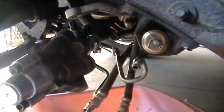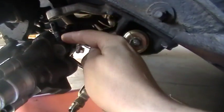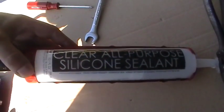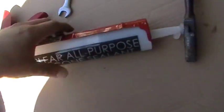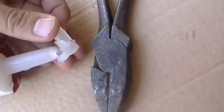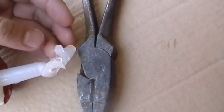I just didn't want to deal with any headaches about what else could be causing this thing to leak. So I'm going to get this back together and see how things are going as far as leaks go. When I took it out and took it apart, I used some degreaser just on the outside to clean it off, and I squeezed some silicone caulk into there and let it sit for about three days. I want to show you the caulk I used — I got this at Walmart for about $2.99 to $4. It's just clear all-purpose silicone sealant, and it's some of the best stuff I've ever used. It turns into this nice flexible rubbery material, which — as a very thin film — would be perfect as a gasket. So that's what I did for the control valve.